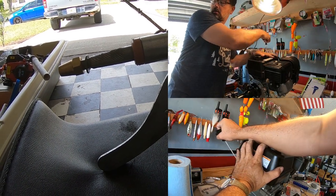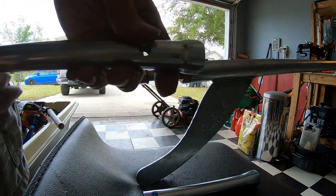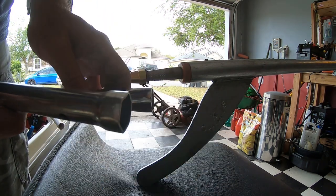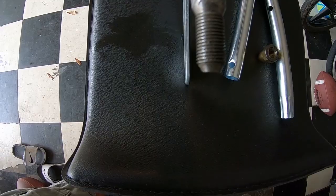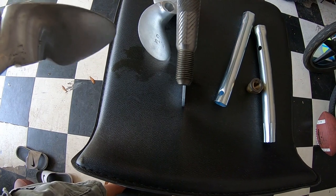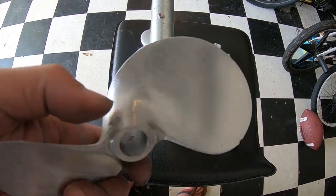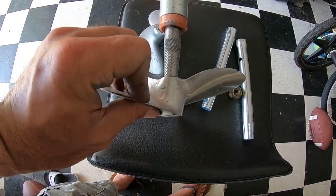You can see that brass bolt is spinning. The tool that came with the Mud Skipper kit — and also the tool that came with the engine for the spark plug — fits that brass bolt too, so I'm just taking that brass bolt and washer off. The shaft is tapered now. The older version had two notches to line up with a keyway slot, but now you have a tapered shaft with threads that grip the propeller. The propeller is also tapered on the inside, so you can only put it on one way.